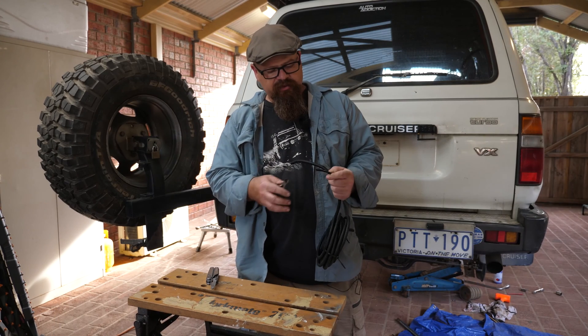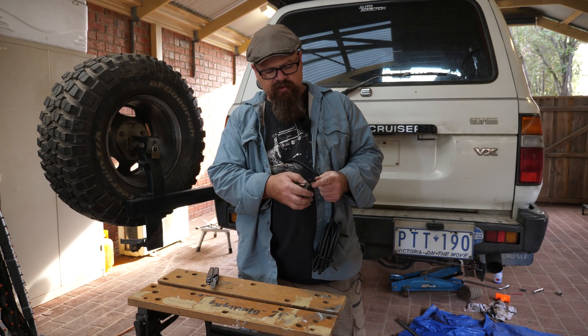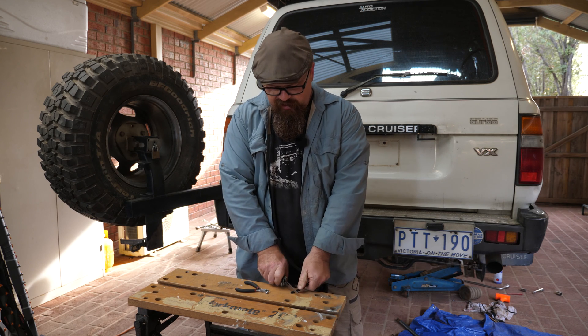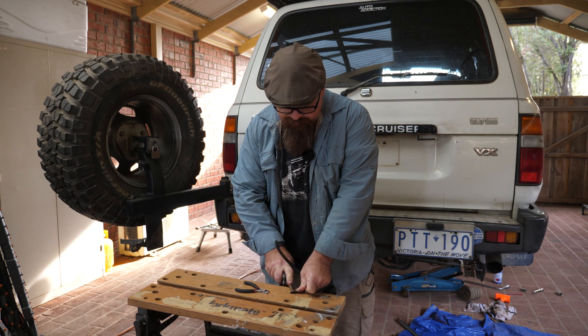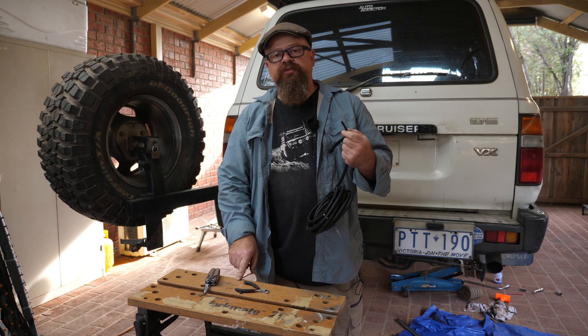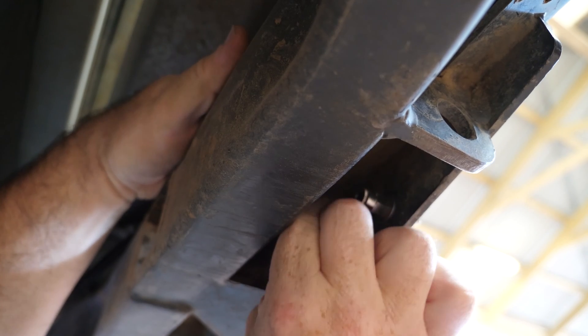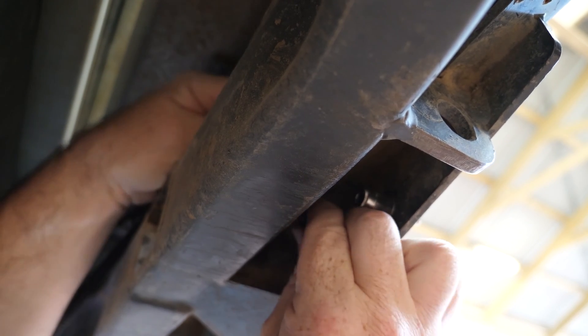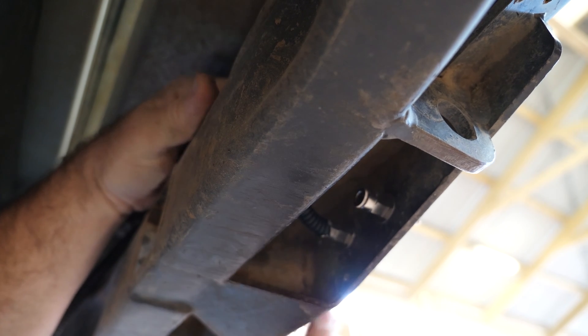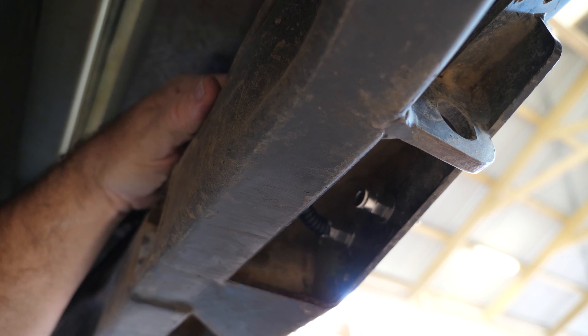Now let's run the air lines. When it comes to cutting your air line to length, don't use a pair of side cutters — make sure you grab a sharp knife. Put it against a hard surface and just cut it off like that; otherwise they'll never seal if you squash them with side cutters. Put the air line into the back of the connection — simply a matter of pushing it home. Then run the hose the rest of the way, zip-tying it every six inches or so, right to the back of the bag.